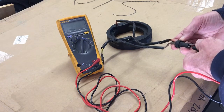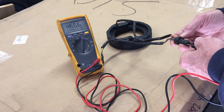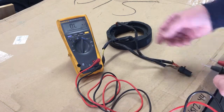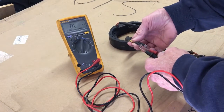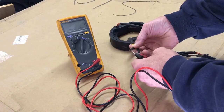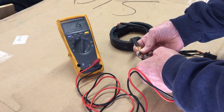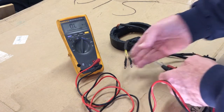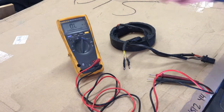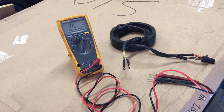466 on the brown coil — should be 450 to 500. The 1.5 charging coil has already been tested, and none of them are shorted to the body of the engine.